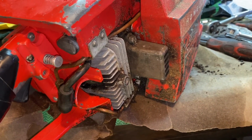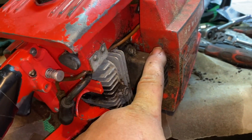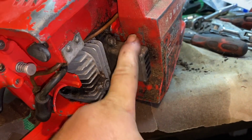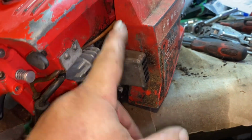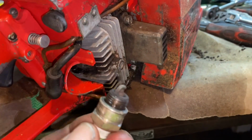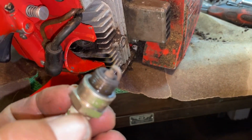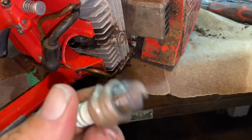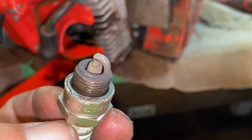That's why I'm thinking about taking the next one and dropping it down several degrees to bring the torque up, to help bring that peak RPM down. But this is intriguing though. As lean as it is, I'm wondering if maybe I should do a change to my setup on this saw.